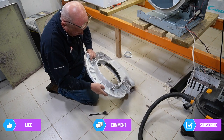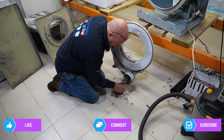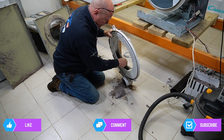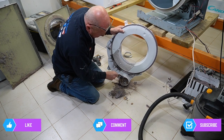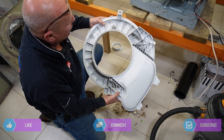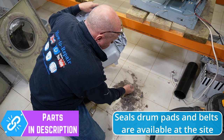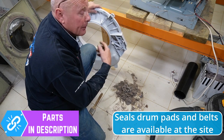I'm just going to tip this on the floor and see what we find. Five pence, a couple of rocks, a bead — you'll be amazed what's in here. But really you've got to clean the whole of this up immaculately. We've managed to get the ducting system completely and utterly clean now. We've done all around the felt pads and also on the ducting inside. We managed to retrieve about £1.40 out of the machine. You can see the amount of fluff that came out of the ducting — this is what was holding back the filter from going into place, and it just built up and built up because of this.